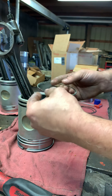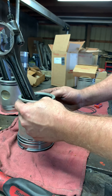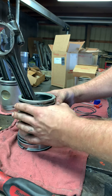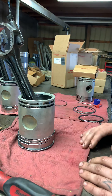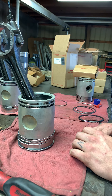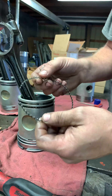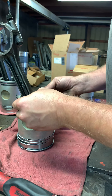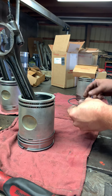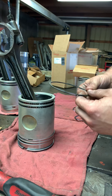And your ring tension rings — I always face the piston like this and put the bottom one in, or top one. Make sure that ring's not overlapping. And then the other one I face this way. It's just the way I do it — you can do it whatever way you want. Sharp side up to the bottom of the piston.